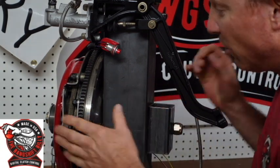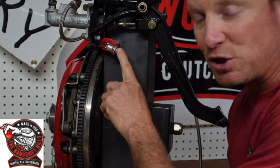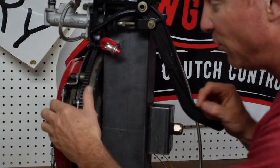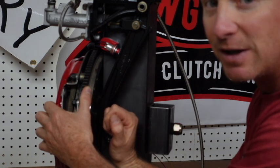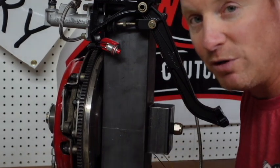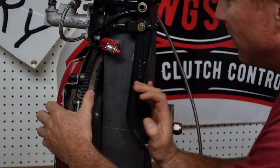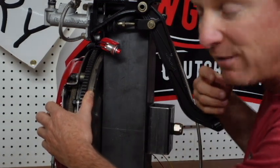This is our test bench with a clutch pedal and a clutch switch. The one on the car needs to be adjustable, not just a push-button switch like this. What it needs to do is know exactly when you lift your foot off the clutch pedal. That click is our switch. As soon as I release the clutch pedal, that switch needs to open because the controller needs to know the position. Normal clutch operation — the first three inches doesn't do anything. It's this last inch where the clutch starts to bite or engage that we need to have control of.